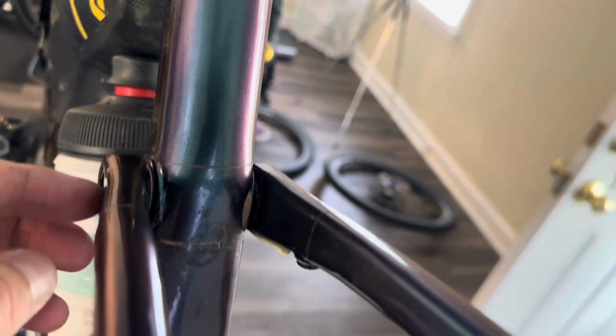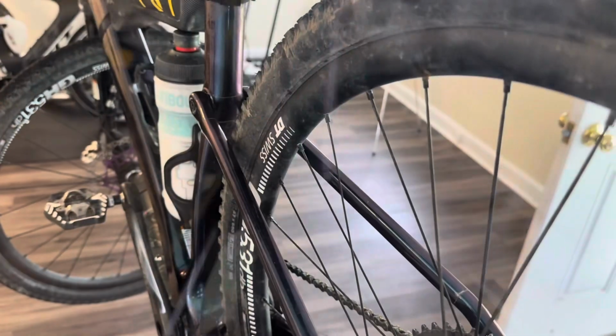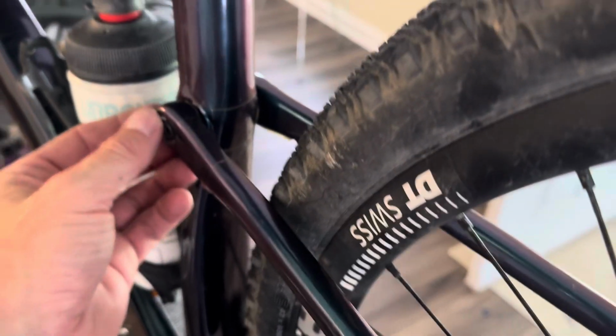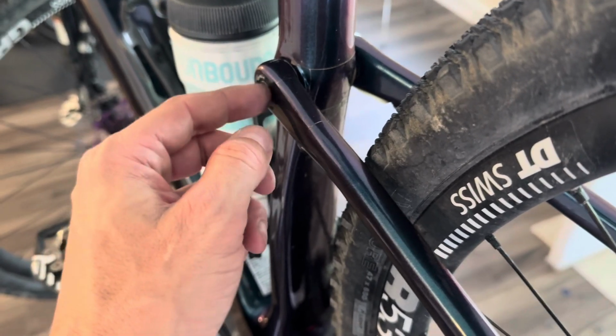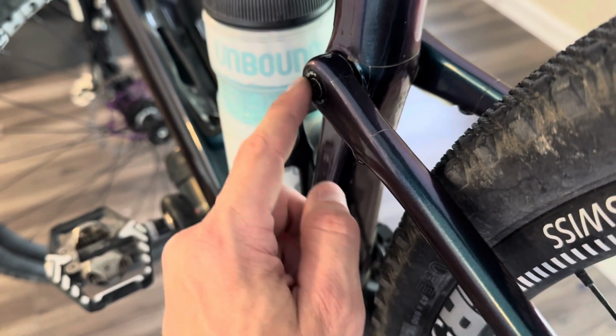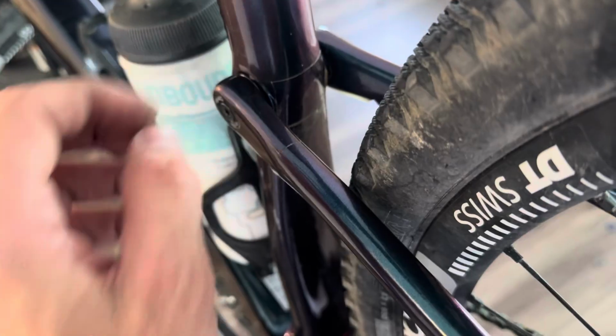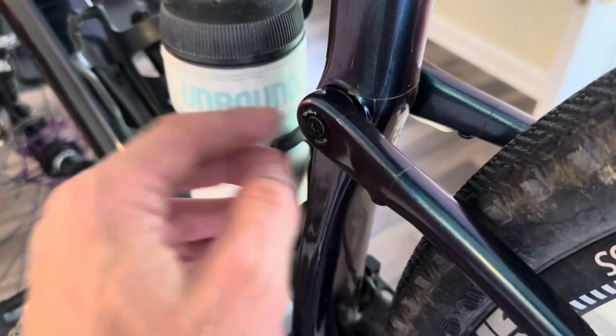The next step here is to install both of the wedges, and then finally the final screw, which is 5 Newton meters. All right, so I got everything wrapped up, everything bolted back together. In the previous clip, I talked about how the axle was torqued down to 1 Newton meter, but this arm still had some play. So what I ended up doing is I just made the arm flush with the bolt, and that gave me about 1 millimeter there. And then to take it back to where it started, there are 2 Torx T25 on each end. So you need to have a socket on each end to be able to torque that down to 5 Newton meters.